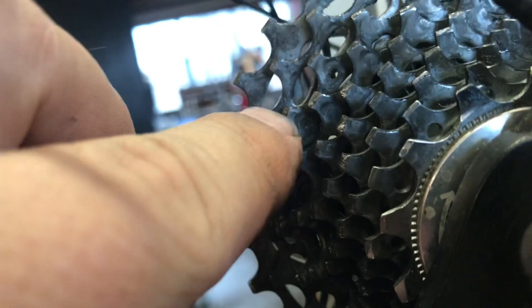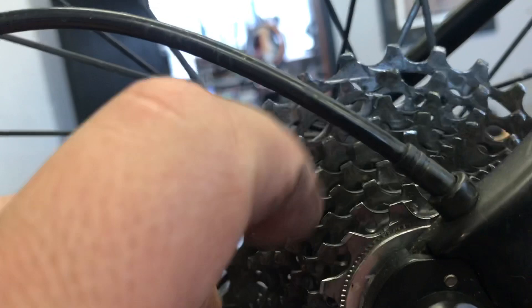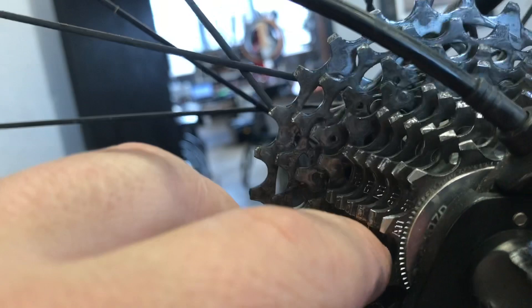You can see the heavy wear usually comes from that shiny round spot around where the pins keep hitting on the cassette as they come in and out. You'll see that little shiny swoop — that's obviously a cog he likes to hang out in the most — but you don't see heavy shark finning. You've got pretty good tooth profiles on the rest of the teeth, so everything looks good to go. Luckily this rider just rides a lot, puts a lot of heavy miles in, but is very proactive about getting in here and making sure things are swapped out. So while the chain is stretched beyond belief, it has not damaged the drivetrain enough to make it an issue.